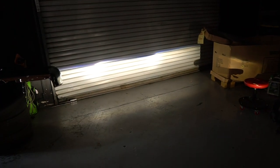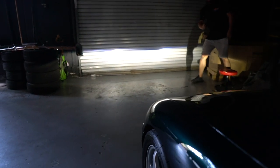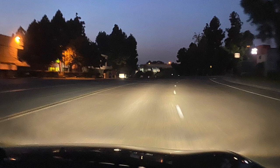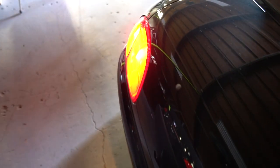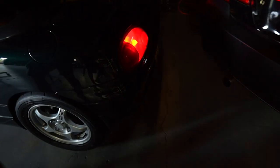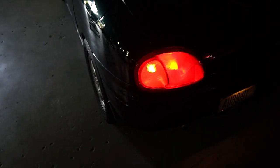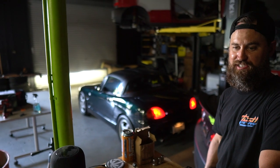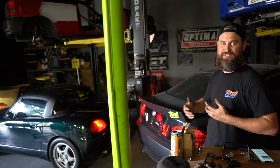For those of you that like to do headlights — you can see we've aligned the cutoff and it's about 21 inches from the floor, which is really great. It's really modernized the front of the car. It's hard to tell in the shop, but it's a much wider light than before. We've also upgraded the turning lights and the daytime running lights — LED bulbs throughout the car. For a little half-day project, it's pretty cool. I learned a few things from Chris here because he has been doing this for a really long time. I wouldn't want to do it for a living — it's definitely a grind, and I wouldn't want to have to do it more than once every few months.